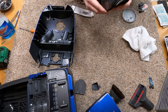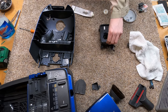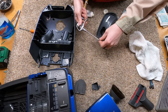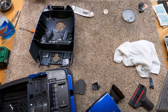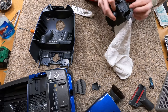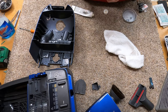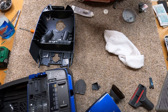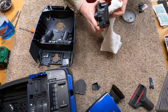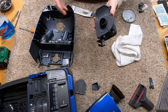It looked like the gasket was holding some water — it's actually been several days since this thing's been washed. We don't want to mix water and electricity together, so I'm making sure with this gasket to blow out any excess water. I've never had one of those hold water before. This piece swivels 360 degrees, and once you swivel it for a second, you can see. Wipe off any excess grease — you really don't want that going in there. That's how the clutch goes together.